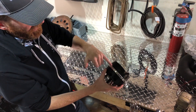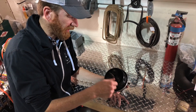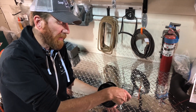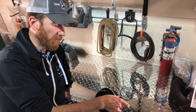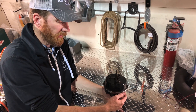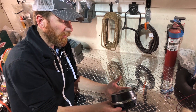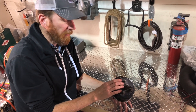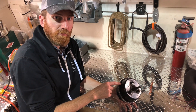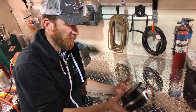This unit has the original band on it. When you buy the aftermarket kit you get a new diaphragm and a new band that clamps on with a bolt. We would peel this band off, put in the new diaphragm, and put the new band on. We'll probably end up getting a new diaphragm and prepping this one up as a spare, because this one is no good.